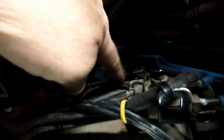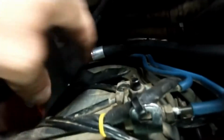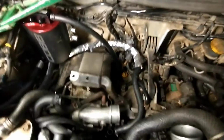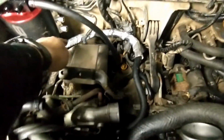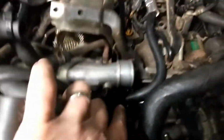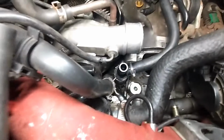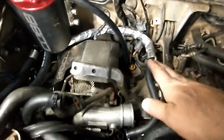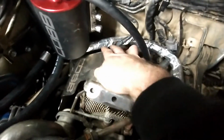two bolts. So there is the one that was at the bottom of the bracket for the brake line, and the other one is going to be these guys that you see here. That's going to connect here. Here you can see the half-inch hose routed all the way to the T-fitting down there. I decided to not cut any of it, so it has a little bit of that curved shape, but it actually pushes the hose as much as possible to the firewall and away from the dust shield. So I like to have that little pressure on the hose.